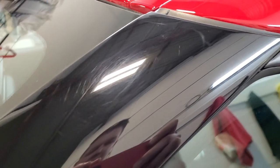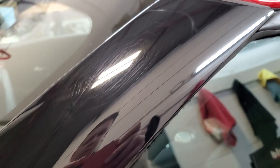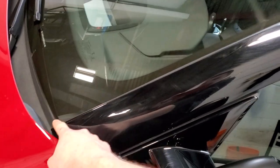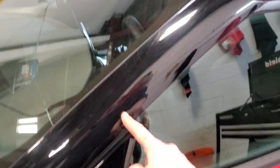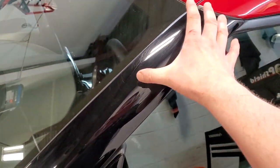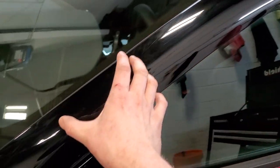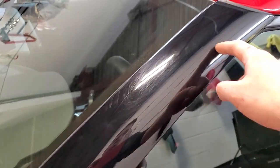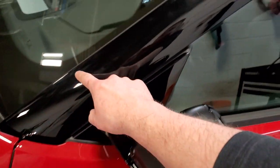There's no need to remove more clear coat than necessary in this circumstance. I'm going to polish about half of the A-pillar — upwards will be perfectly polished out, the lower area will still have swirls in it. I'll remove the tape and we'll see the difference, then apply paint protection film across the full panel and see how it looks.